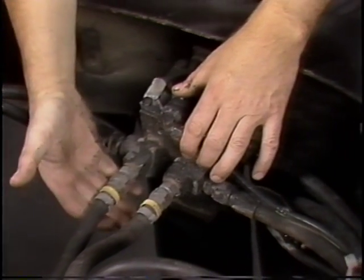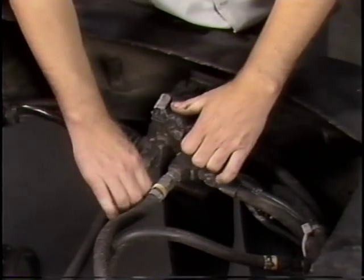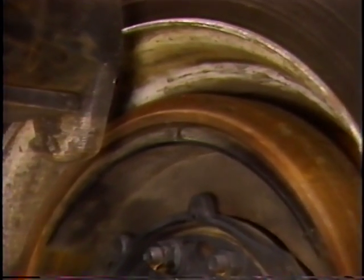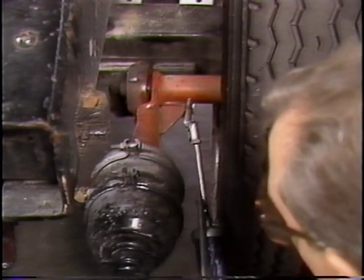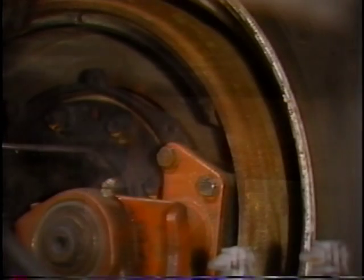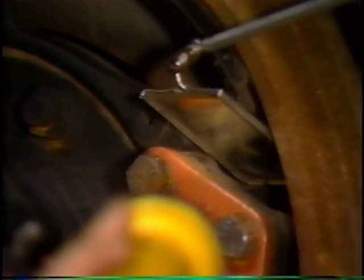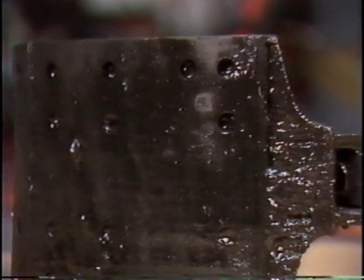To perform a minor inspection, begin by checking the air system for leaks, which includes checking the chamfer at the center of the shoes. If the chamfer is not there, the brake shoes must be replaced. A minor inspection also includes lubrication — start with the camshaft. When lubricating, check to see if grease flows from the seal near the cam head. If leakage is observed, remove the wheels and brakes to replace the seal. Also remove any grease from the cam head and rollers and replace the linings, as grease on the linings can cause poor brake performance. Finally, make sure you lube the slack adjuster.